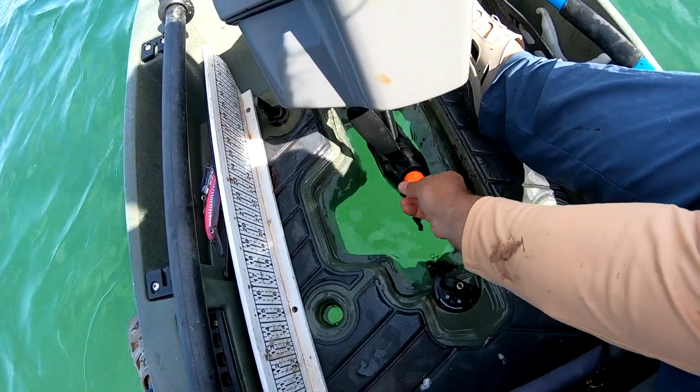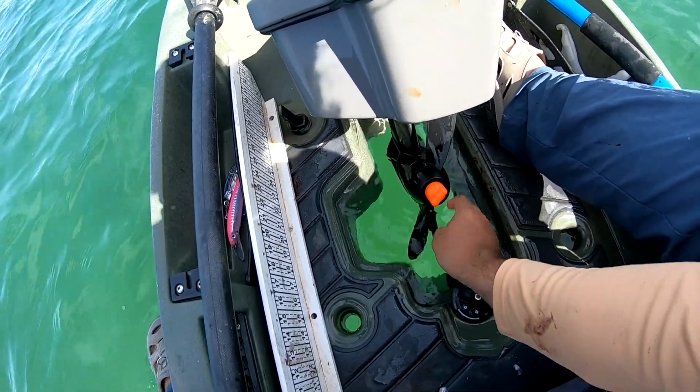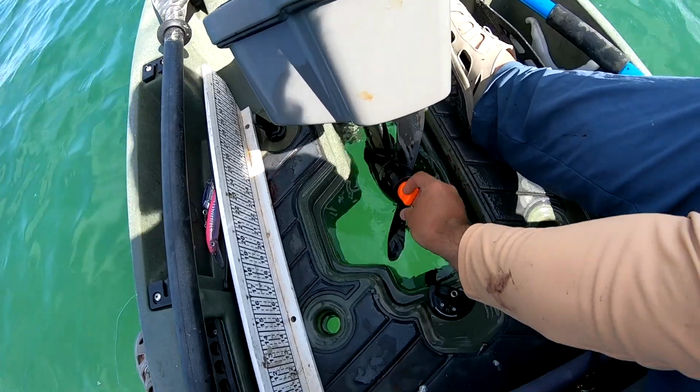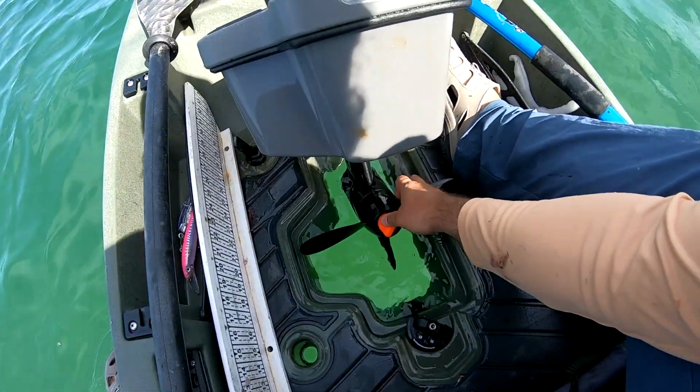I had some guys go, well, if it was metal, it would be better. Well, that's not true. Your nylock nut, your metal nut, actually has nylon in it, and that's a type of plastic that actually holds it on. So the plastic threads right here will go on in place and hold it there without any issues. I have the original one we made on a Predator out there. Never changed it. It's good to go.